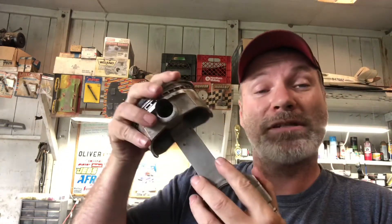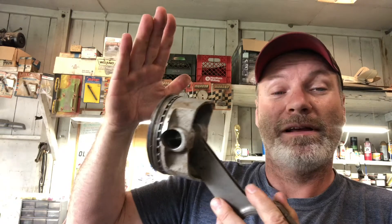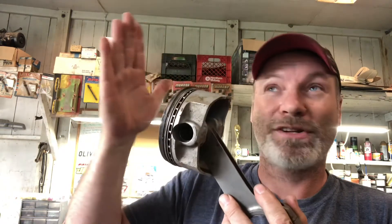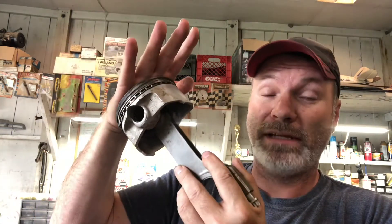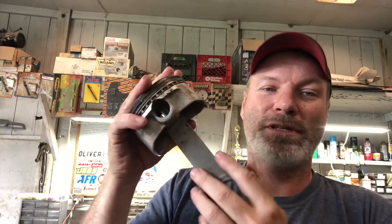It's not just the weight — every power stroke, when the spark plug fires before top dead center and the piston starts heading back down, that initial burst is another jar in the whole assembly and in the crankshaft. That's where harmonic balancers come in, because they help absorb some of that. But they can only do so much.